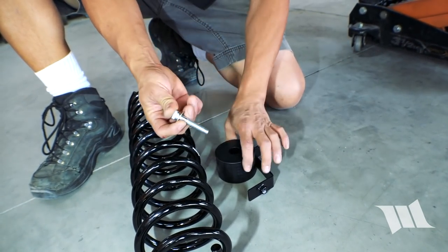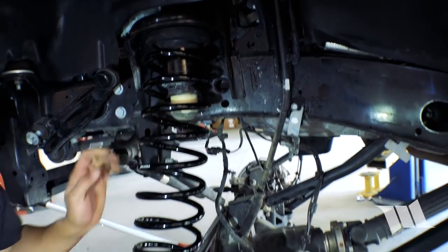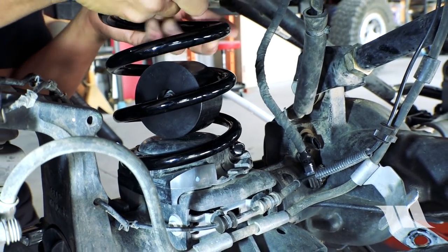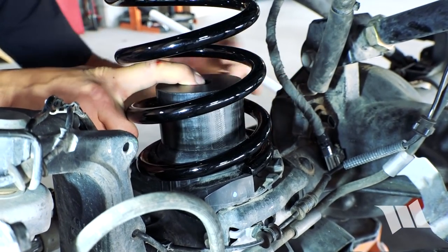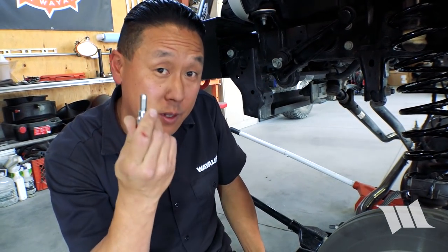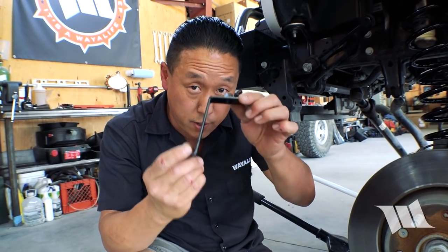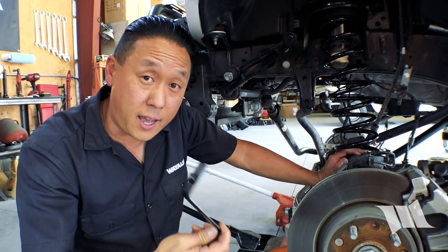Take the bolt, slip it through the washer into the bump stop extension, place it underneath the coil, slip the coil in, and slide it into place. The lower isolator is indexed so rotate the coil until it's positioned correctly, then take the bump stop extension and slip it into the coil. To secure the bump stop in place, you need a 5/16-inch Allen wrench or 8mm bit — I like to use it as a bit because it's easier to work with. Dynatrac was very cool to include the flagged nut — getting these secured to the axle is actually quite a pain without it.